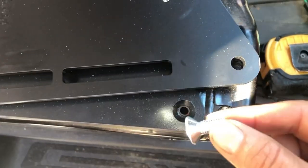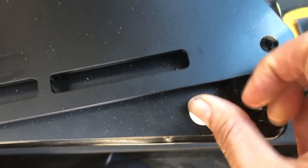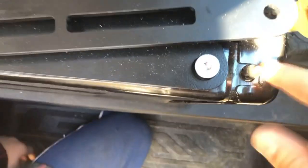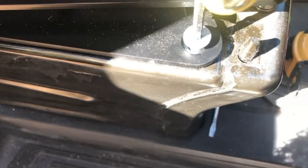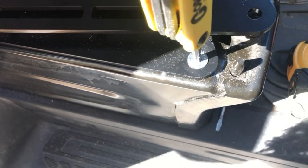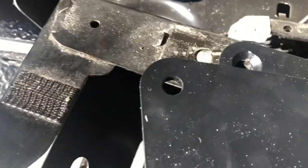There is a bolt with an angle to its head, and that fits perfectly into the recessed hole at the end of the bracket where the swivel mount fits into the base mount for your seat. Take an Allen wrench and screw it in. It's going into a nut that's actually welded to the seat base underneath — you can't see it, but it's there. As you screw the bolt in, you'll feel it gripping into the threads of the seat base as well as into the welded nut below. Do this four times, one in each corner of the swivel.